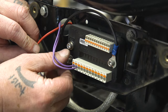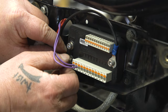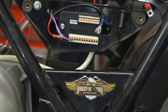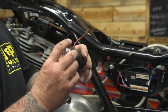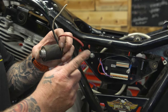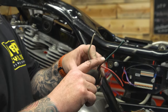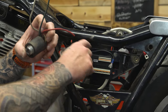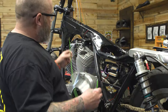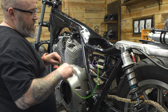This terminal down here is marked battery, and we will attach it right there. Since we didn't hot this on the other side, this isn't hot yet. We're using our stock key switch here, and we're only going to use two of the three terminals. We're going to use our B-Terminal — in our case this is red wire — and that is going to go down here to the battery terminal on the M-Unit. Then we're going to use our S-Terminal, which is in our case the green wire, and that is going to go over here and get plugged into the lock terminal. So we're extending our wires to come down here to the M-Unit. I'm going to plug the one into the lock that goes to our green, pull it up here, cut it, and solder it.